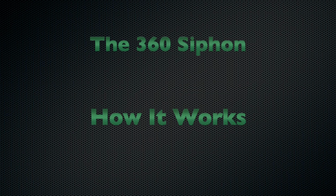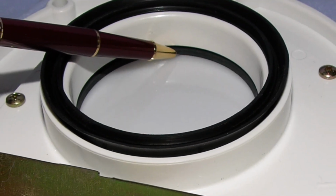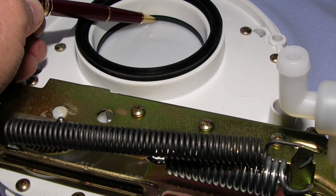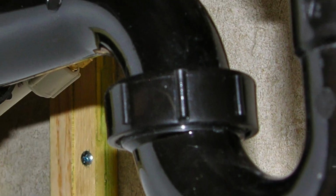Here's how it actually works. When air moves over any RV, it naturally and automatically creates a positive pressure inside the holding tanks. With a positive tank pressure, odors can be forced past defective toilet seals and improperly filled P-traps, for example.